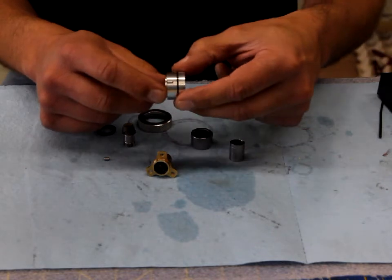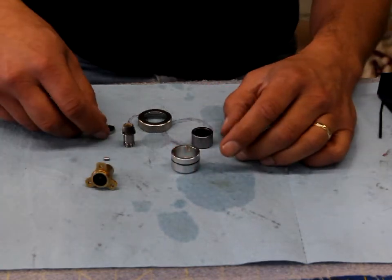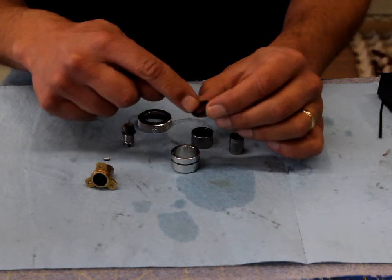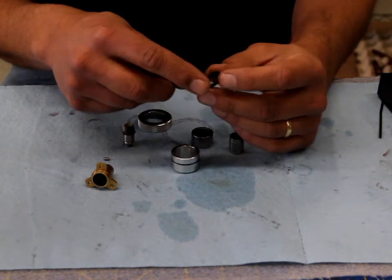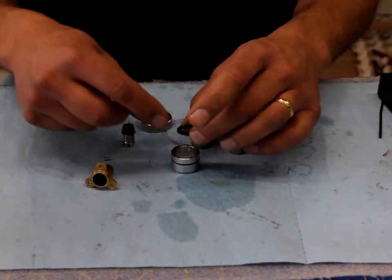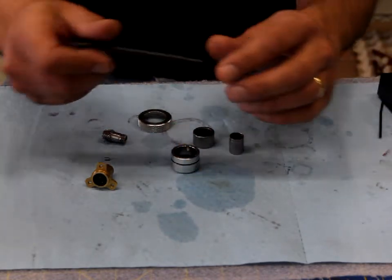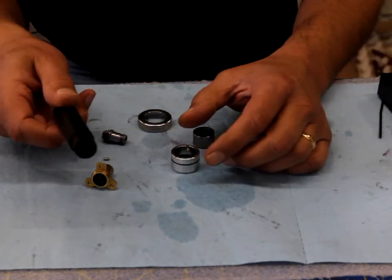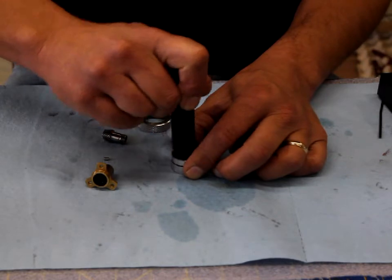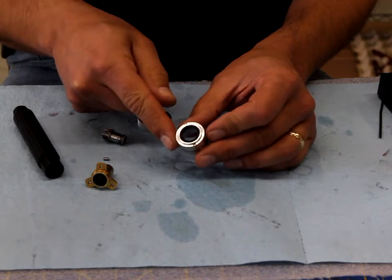Once the o-ring is ready, I want to make sure that I have both pins still in the clutch housing. I'm going to take the clutch housing, turn it upside down, and take my main seal. The main seal has two sides: a flat writing side, and on the opposite side it has a groove going around the center. I want to place this seal in the clutch housing so the groove is facing down and I can see the writing on the flat side. I'll drop it down in there, then take the blunt end of the seal tool and press the seal into its raceway — I can feel it snap in.